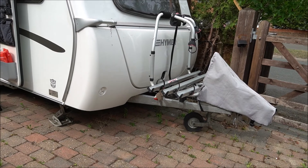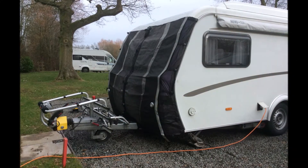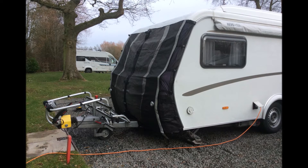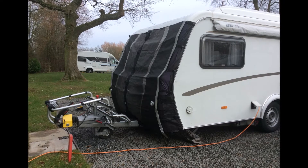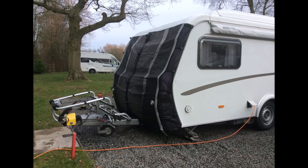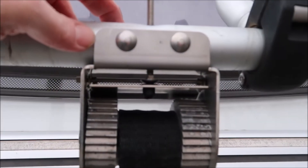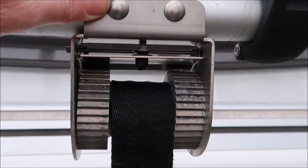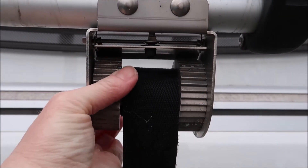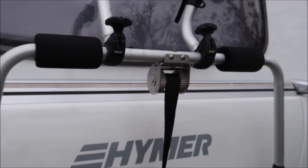I accidentally left the rack tilted and held down under the hitch using a webbing strap, and it was left there all night. The next morning the ratchet mechanism seemed to have lost some of its strength — it wasn't reeling the built-in webbing all the way back onto the ratchet wheel. We fixed it at home, but it took a couple of pairs of technically competent hands, split pins, needle-nose pliers, various screwdrivers, and holding things under tension simultaneously. It's doable for the technically minded and well-equipped, but not everyone — so certainly something to watch out for.